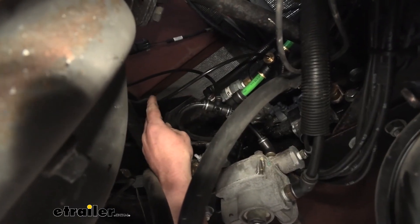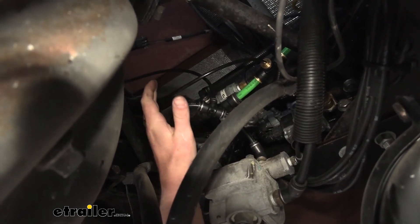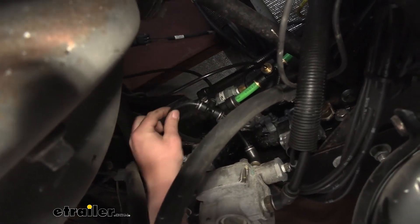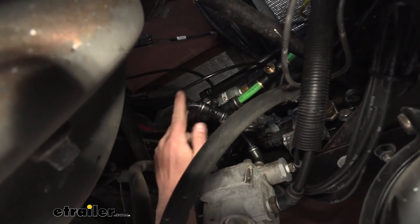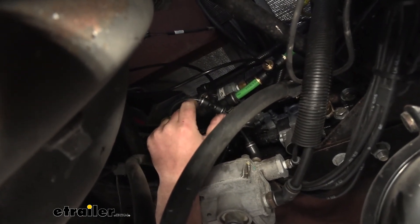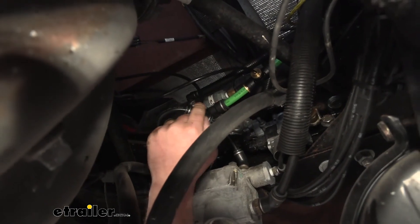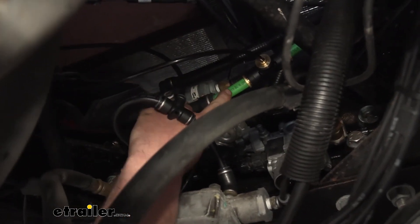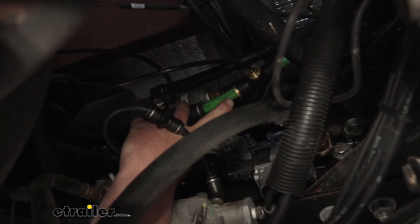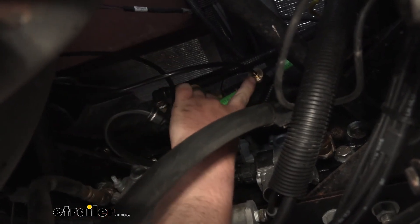Here's where our two airlines come above the axle and where we tee them in. Before cutting the motorhome's lines, make sure the air is drained out of the system — just hit the brake repeatedly until all the air pressure is gone. The metered air line gets cut in half, a T-connector is put in, and then the metered air line from the tank in the back of the motorhome plugs into that. The large thick green line is the supply line: cut that in half, plug in the larger T-fitting, and take the supply line run from our tank in the back and plug it right in.